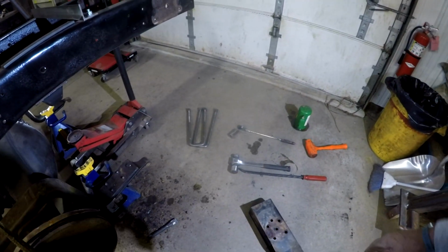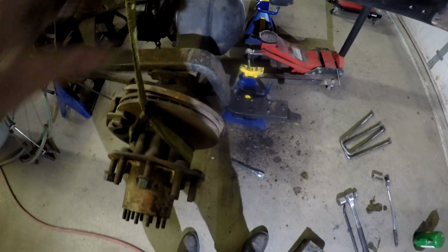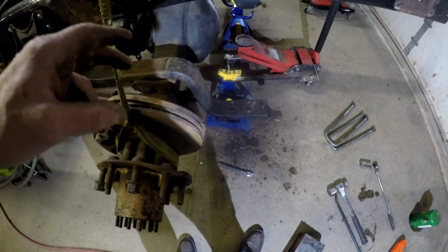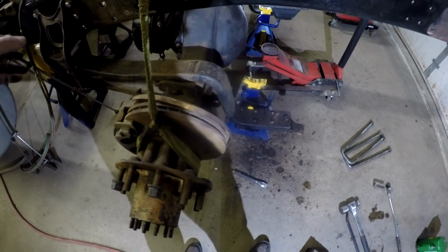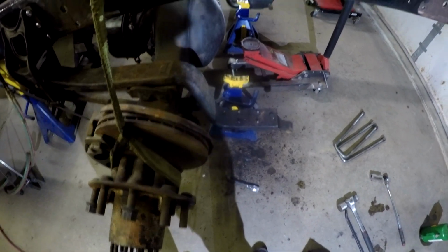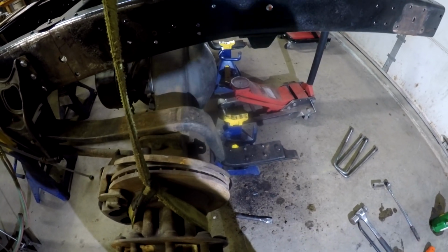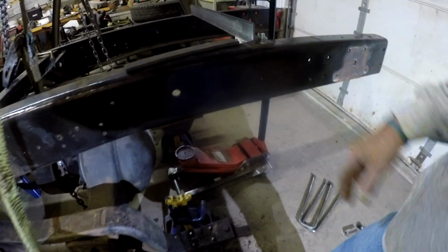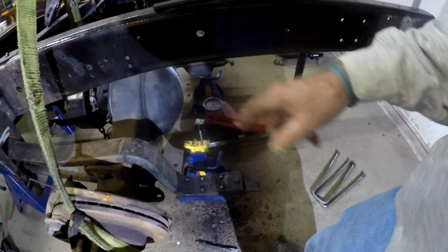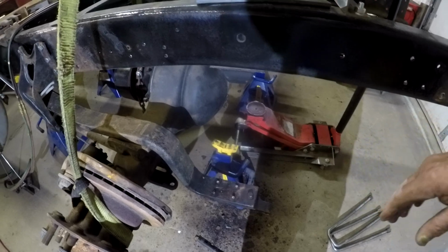What I had an issue with is I think that the way this bracket was configured, there was a little bit of difference between the frame rail spacing on the truck that this came off of and this truck. So when I mounted this all up and put it on here, this appears to be a little bit wider than what this air suspension came off of. So I might have to readjust those bolt holes.